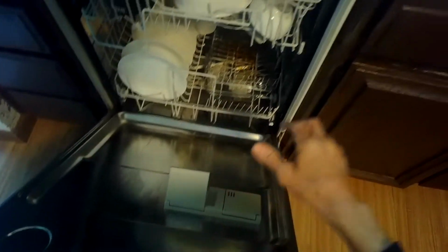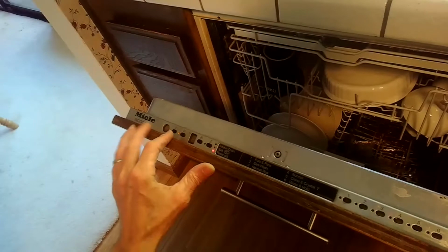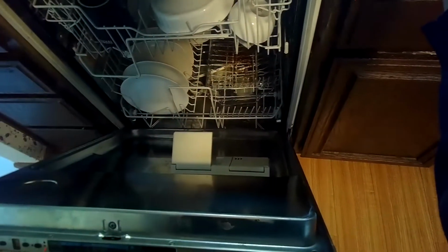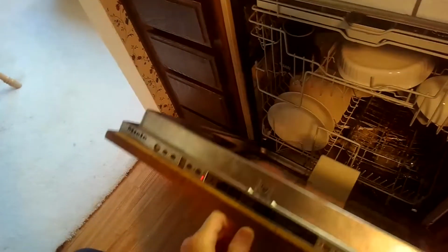So the circulation motor sounds really good after replacing the capacitor. We'll see if it can do the whole cycle now and not give up near the end. So I think it made it through the full cycle. There's no intake drain light. Everything's clean and it drained out the water. So that's what that needed, is that capacitor. That's how to fix that F-08 problem where the circulation motor runs, cuts out over and over. Just a new capacitor fixes that.